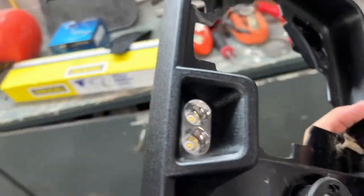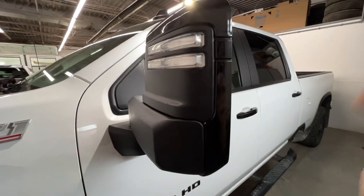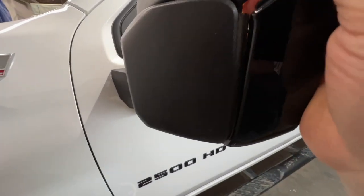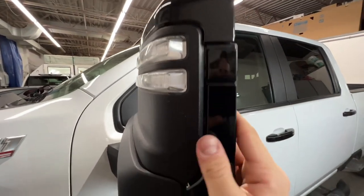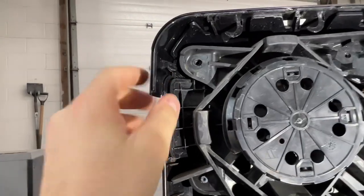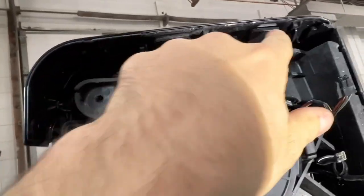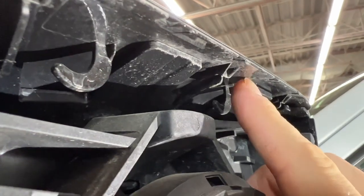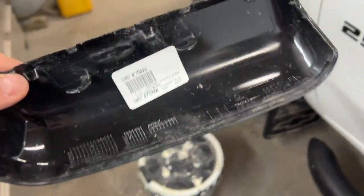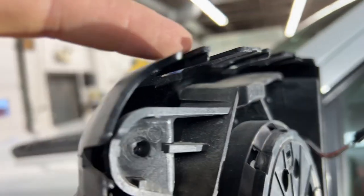Now to remove these two pieces — they're not one piece. This piece is kind of a pressure fit so it pulls out really easy; it kind of hooks around there and goes underneath — that's how it comes in and out. Now for the top cap, there are four tabs, so you want to get in here and make some clearance for it to clear. There's a little notch on the back side — here's what those tabs look like. That notch slides into this groove, comes over top, and snaps down.